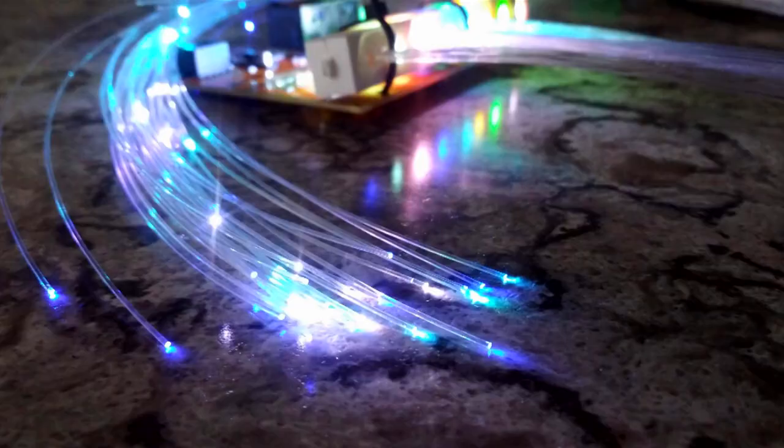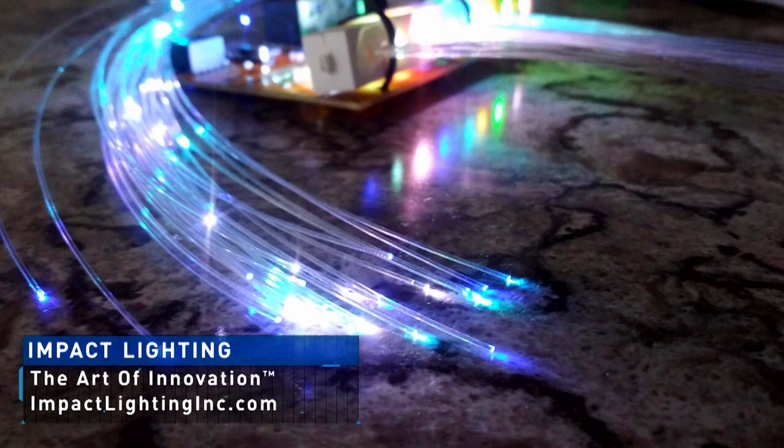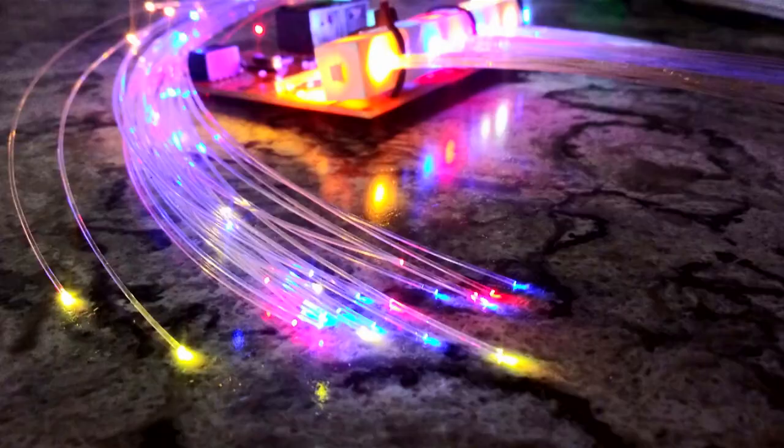The reason I say that, too, is because another idea that I wanted to do to this is put fiber optics in the flames. Fiber optic is a lighting that goes through a filament and the tip lights. So my original idea from when I was younger was to drill about 4,000 holes into the flames, pull the fiber optics through it, glue it, cut it close to the body, and then buff it smooth so you can't feel that. But at night, the flames will light up as I drive down the road. I haven't fully committed to that idea.